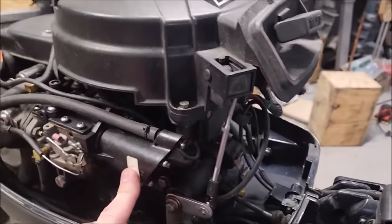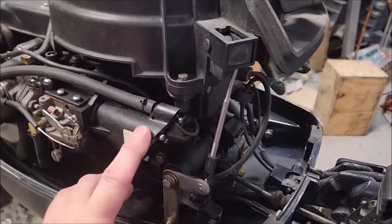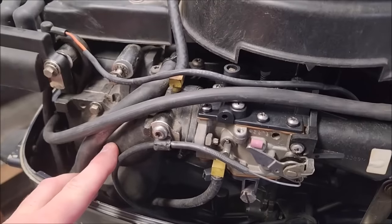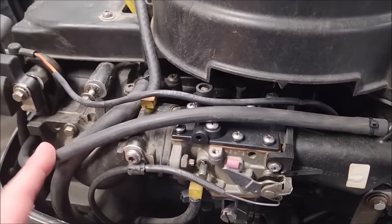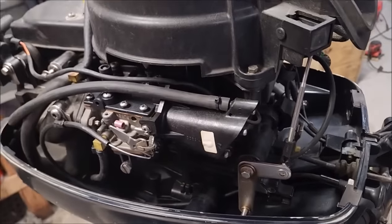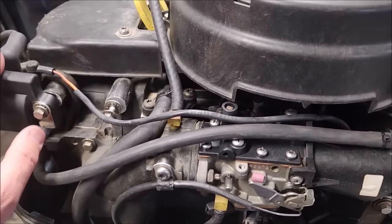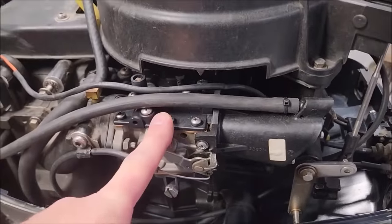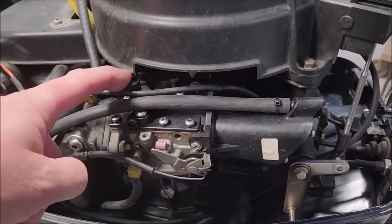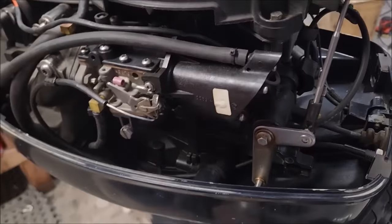It's almost like it'll draw fuel if the throttle is open fully, choke closed, so we get fuel into the intake here, it'll start. But once you need more fuel, it'll die. Or less fuel, it'll die. Oh, and it'll only run for a few seconds. So I put on this coil, and I was like, okay, maybe the ignition coil's getting hot and dying. No, it's not, it's sparking. So you say maybe the carburetor settings are bad. Yeah, that needle helped. If I made it rich as can be, it helped a lot. That's what made it actually kind of start.